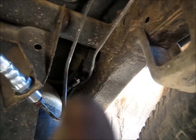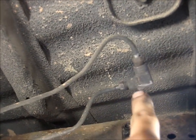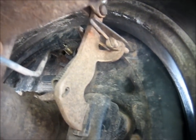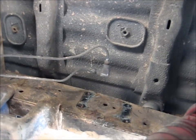And then if you head to the rear, you can see there's a line that I cut. That's the return line that comes from the stock LSPV to the T junction that is now gone and turned into an L. And then I got another one of those L junctions and put it where this line comes from the master cylinder — it would normally go into the LSPV, but now it goes into this L, and then it goes to the rear brakes. You can see I have another stainless steel braided line here that just goes to the rear brake. Now I didn't replace the drums, but I did replace the wheel cylinders. I got wheel cylinders from Advance Auto Parts that fit a 1990 Toyota Land Cruiser — those bolt right in, but they're a larger diameter, so you get better brakes in the rear. The only thing I haven't done is secure this because it's kind of wobbly, and I don't know if over time that would fatigue the lines, so I'm just going to make a little bracket and have that secured.